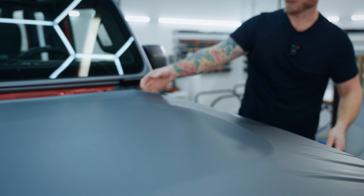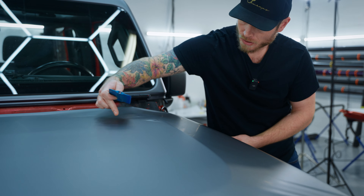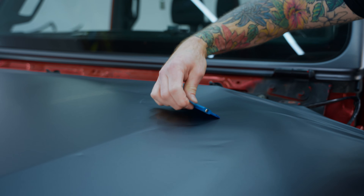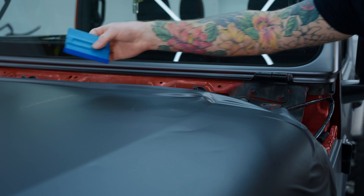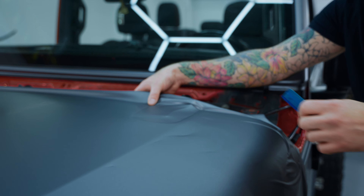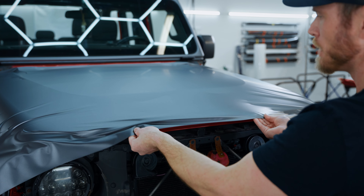Like a lubricant for wraps — not for oil changes or greasy hinges. Reset that. One more time here — bubble right there, nice. I'm always overlapping those passes making sure I'm not leaving any air behind. If you leave an air bubble in the middle for a long period of time it's going to be a nightmare. I'm going to move on to the front section over here.